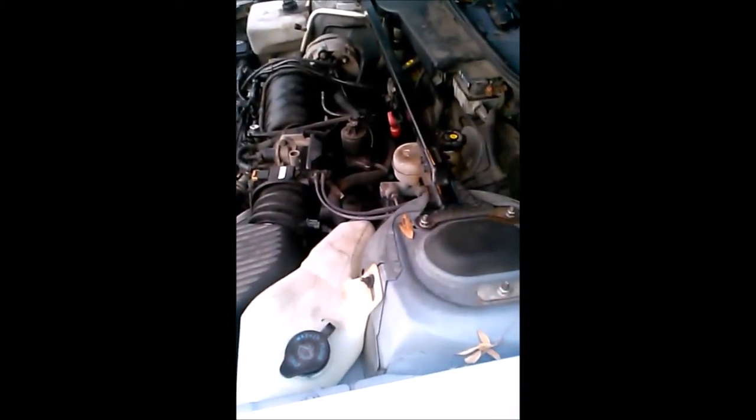Howdy, tubers. I'm back again. As you can see, no smoke. And if we go over here, ticking is gone. Just a normal lifter. Must have been lack of oil in the lifters because of the gas that was in it. I got that C-clip in. So now gas is not spraying everywhere like crazy. It's running really nice. Had to get the firing order correct and everything.